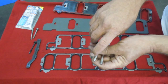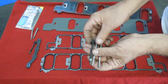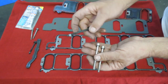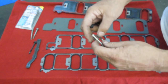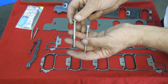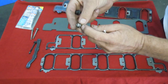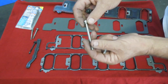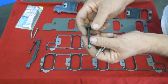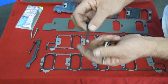But if you have a problem with taking the top two or three threads out of your head, these ARP bolts are what you want. Retap the head, make sure the threads are nice and clean, and go for the 80 millimeter bolt. The biggest problem with these is since they're longer, you've got to make sure you actually have some compression here — I've seen it bottom out in the hole first and not pull enough compression to pull the manifold down tight. Make sure these don't bottom out.